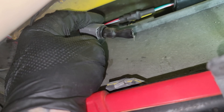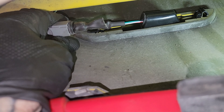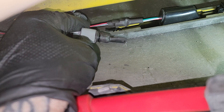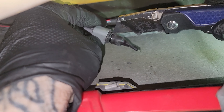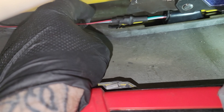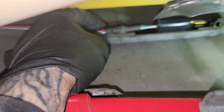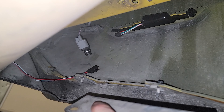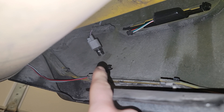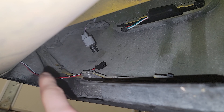We already have the Striker light side marker kit in. We're going to be adding the rear bumper lights, so what we're going to have to do is cut off all the heat shrink on the connections because we're going to be making new connections. There we go — everything all the shrink wrap off, everything disconnected. We're going to go ahead and connect our control harness into the old light socket and wire it into our side marker light and our rear reflector.